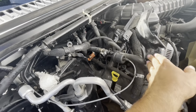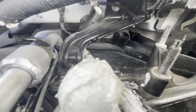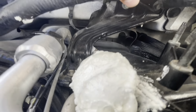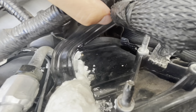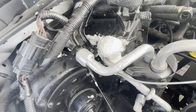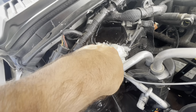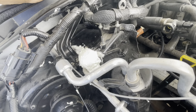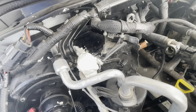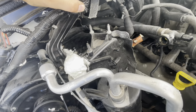I got that bracket moved off, out of the way. I did forget to mention - you don't have to, at least I don't think you have to, but I'm going to take this bracket out with the two bolts up top and the two down there just so I can get easier access to the top here. You'll notice this white foam - I didn't have any sealer, so I just took a little expanding foam along the edges of this. There was a hole down here that was cracked, so last time I was in here I put some expanding foam in there to seal up the holes.